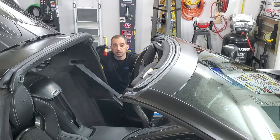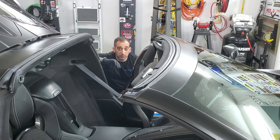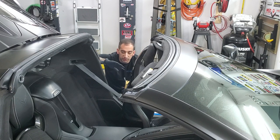It is a little more difficult with the tighter quarters but you can make it work. Right now the battery is connected — I have not disconnected the battery. So anytime I take anything out of here, I'm not going to disconnect anything electrical, with the exception of one speaker — the middle one — and that's it. That one is not going to cause a code or anything to be thrown. Things like the wireless charger I'm going to leave connected throughout the entire video. Keep in mind: if you're going to disconnect anything electrical, remember to disconnect the battery first.